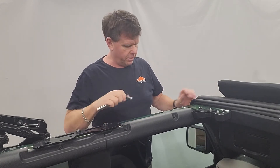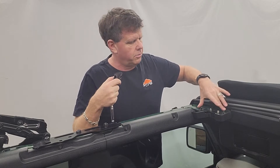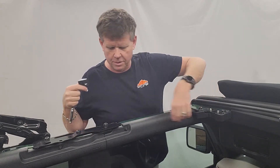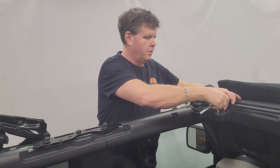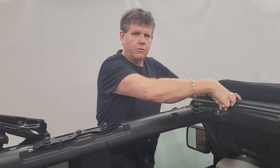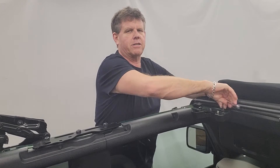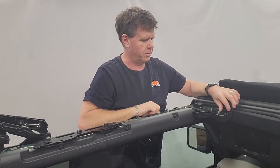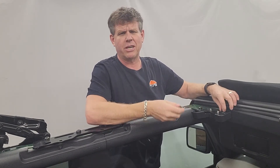To install them, we're going to start at the front. We've got two on either side where our clamp is for our soft top roof, and three brackets down the side of the roll bars on each side. When you're taking these off, do one at a time because you don't want to change the adjustment on your roof latches. Your roof latch is on this metal bracket that's loosening off, so put one on, crank it tight, then do the next one.